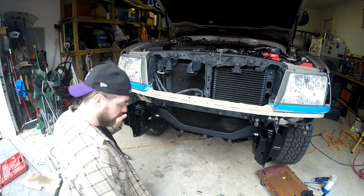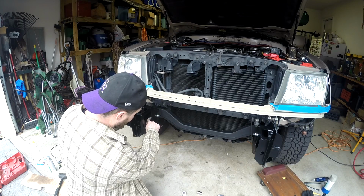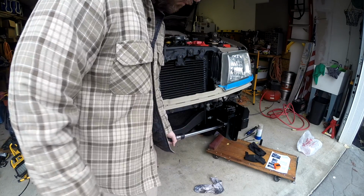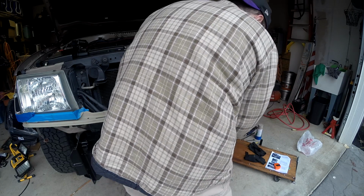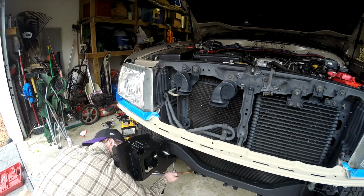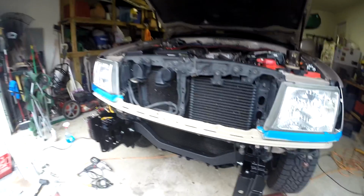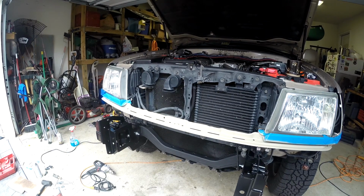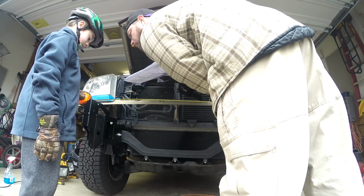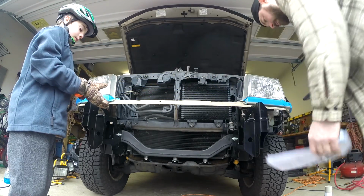Okay, I could not successfully find any torque specs for this stuff except this bolt that goes right in here. So I'm doing these guys on the inside at 43. When all the bolts are fitted, the width of the chassis bracket and bolting surface should be 860. 33.875 inches equals 860.425 millimeters.